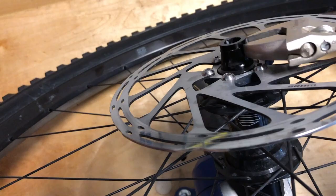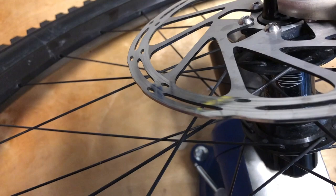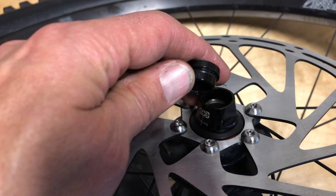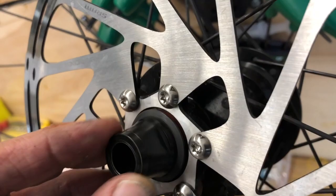From here we're going to remove the axle to get the freehub body off. On the drive side there's a little 17 millimeter flats. On this side there's 18 millimeter flats, but you can either just undo that thing, or in this case I'm just kind of weaseling a little adjustable wrench in there and you pop that little cap off. You can either run the flats there, set it in a vise, just however it's easiest for you to get it off.